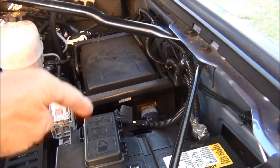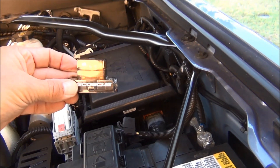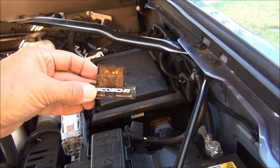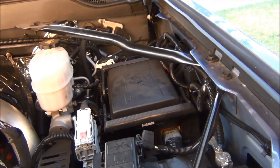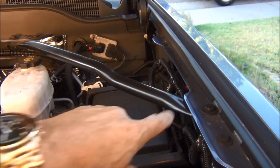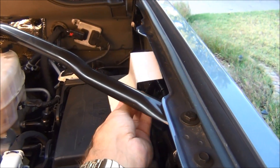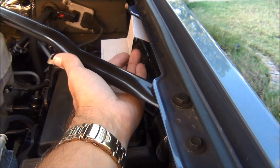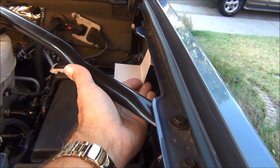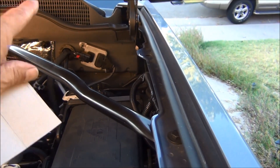One thing I need to do is when I tap into the power, I need to have it fused. I got these big fuse blocks and I'm going to have one on both the power and the ground lead, because a lot of radios are wired that way with fuses on both sides of the circuit. I'm going to make a bracket that fits under this tab here — I just made a cardboard template — and the fuse blocks will mount on the aluminum piece I make, then run down underneath the truck to the back.